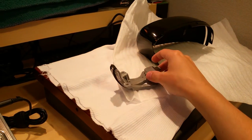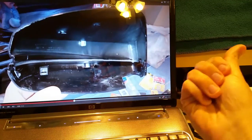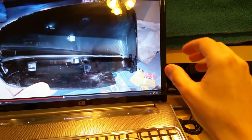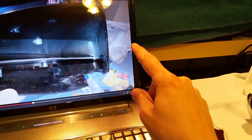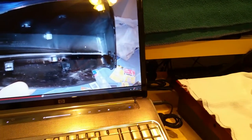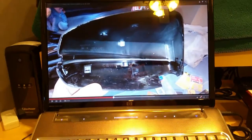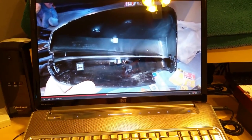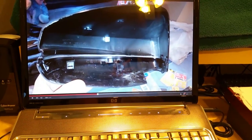You take that wire, run it through the mirror, through the pivot point, down through where it comes out, through the door, and then up between the door and the cabin through that weatherproof accordion piece — that's a pain to snake anything through. Once inside the cabin, at least for the left side, there's a grommet right above the steering column that goes through the firewall — the same one I used for my trailer brake controller wire. I'm going to do it that way because I don't yet know where the blinker outputs are near the aux fuse panel. Honda seems pretty tight-lipped about the 2015 schematics. The easier way is to just run a long wire through the firewall over to the front blinkers.